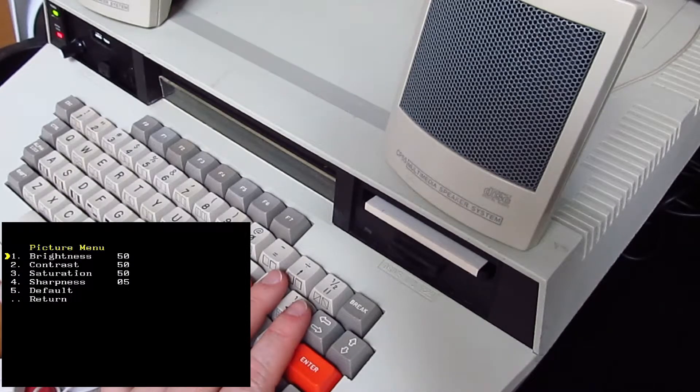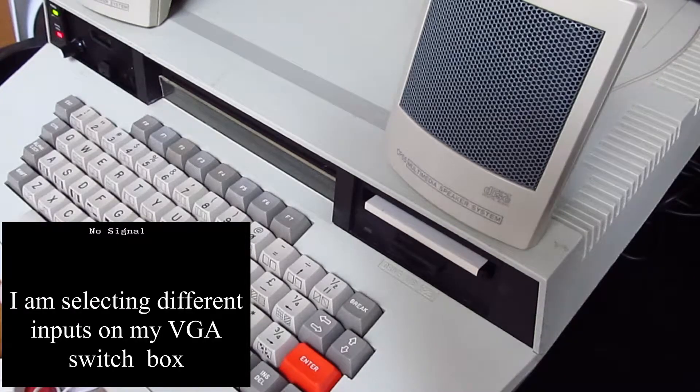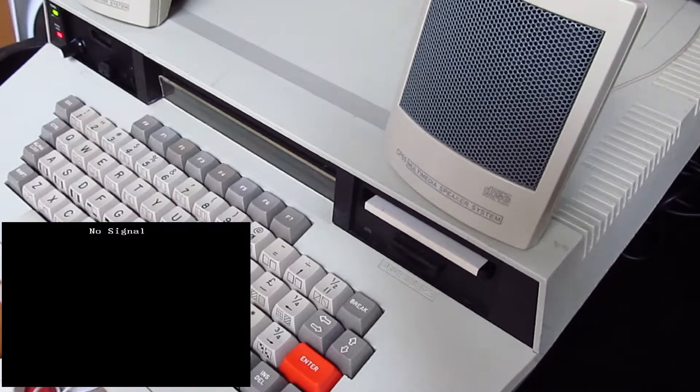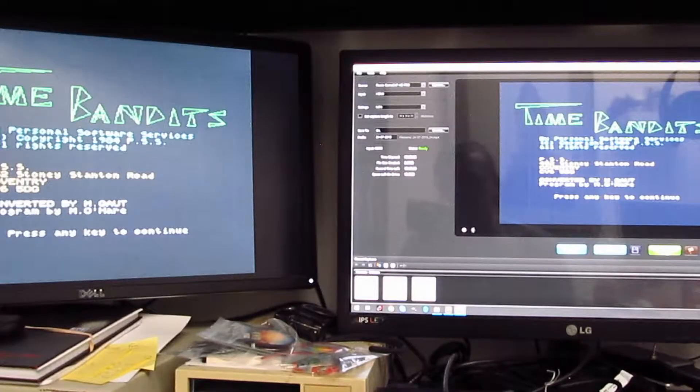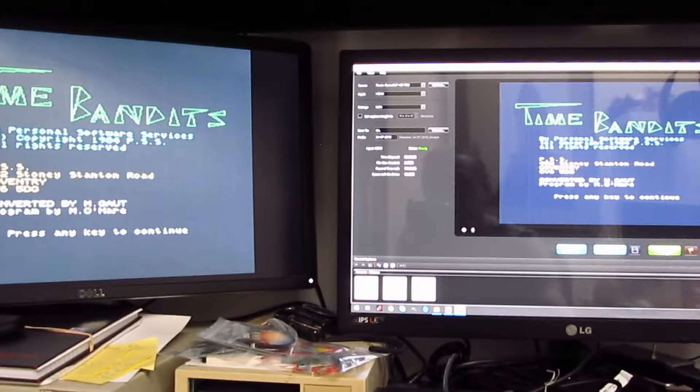Does it have to be pass-through? No. I think I may have got this wrong — let me check and rewire back in a minute. A few moments later — whoa, right, now that was an effort. So now I've got the board down here, configured for VGA input at 640 by 480. And as you can see, the Roxio is ready to capture, and the pass-through to the external monitor is working so I can see what's going on.